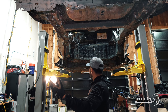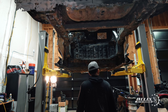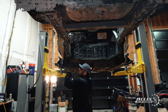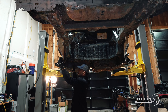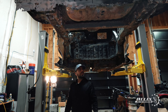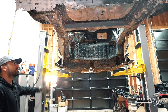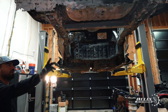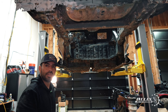The chassis support frame is off the car. The car is in position and the only thing we need to do now is put our homemade chisel and slide it all the way through — about 23 inches across here and 23 inches on top. Something to think about is we should probably put jacks underneath this bar so the rear section doesn't just drop on us. Hopefully nobody gets hurt — that would be kind of funny on camera.